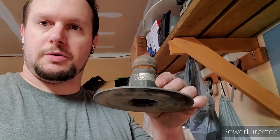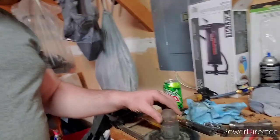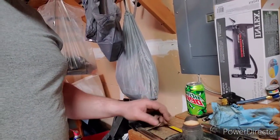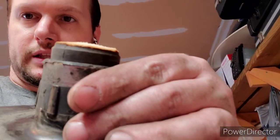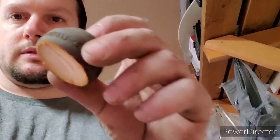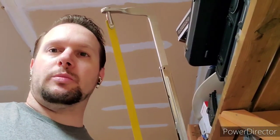Alright guys, and you got to remember too, when you go to put these back in, you got shorter springs, so you need more room for the spring to give. So there we go. I cut it right at the little round part where it's rounded in. Just cut it right off with that, the extra thing here, and they're not hard to cut. Same thing I use with the front. Takes like 2 minutes with one of these, not even 2 minutes, just a couple seconds really.